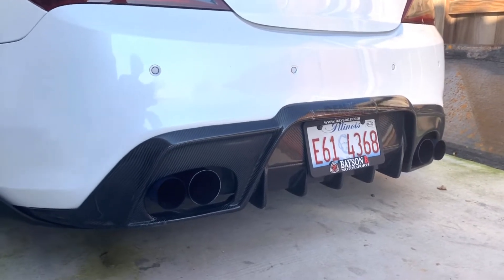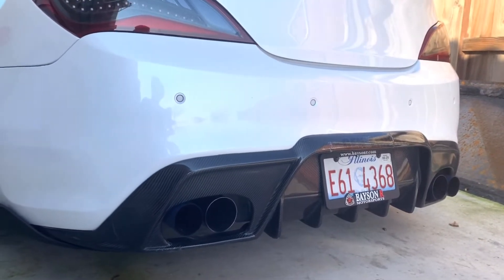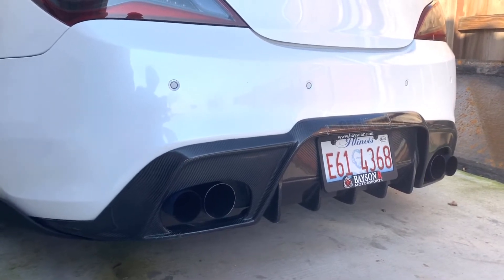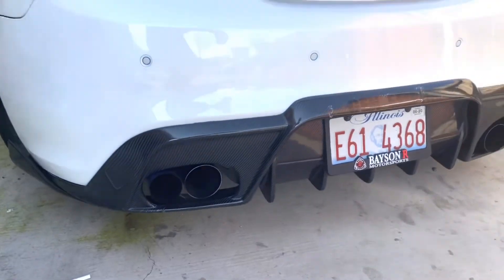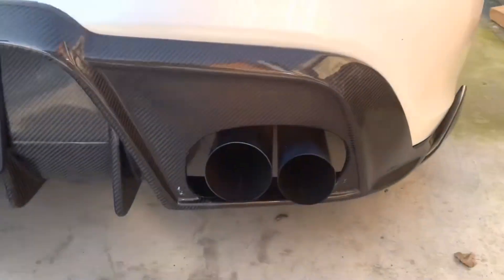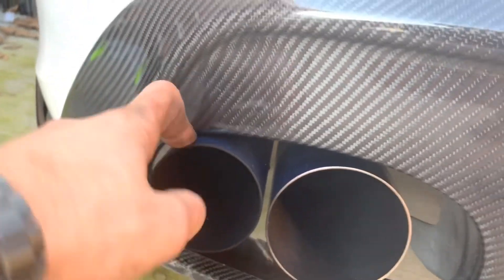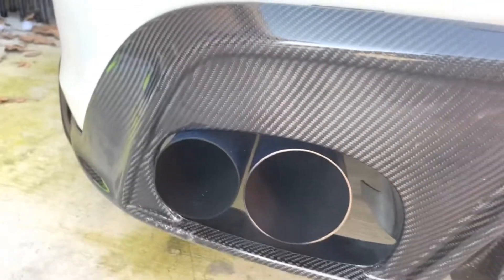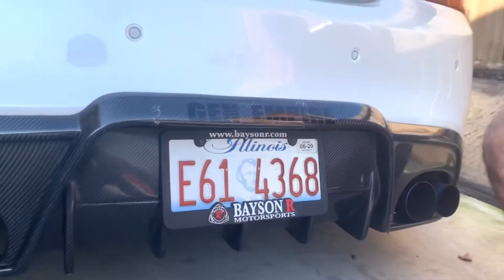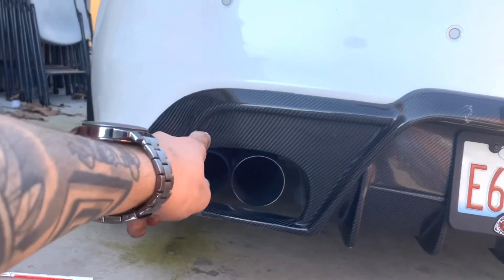Something's loose back here. You hear that little rasp after? I don't know what's loose. Oh no way — those downpipes tossed off the center of my exhaust pipes. Look how this one is, and now this one hits right here. So when I installed the downpipes, they fit a little more snug and it changed the center of my exhaust. That's no good for my diffuser.